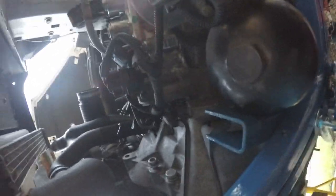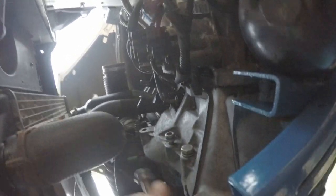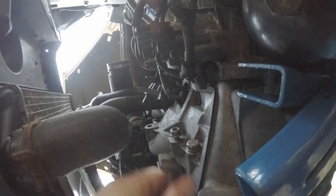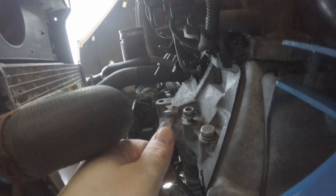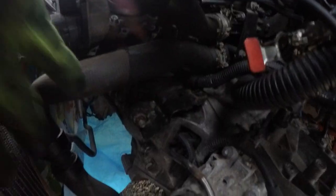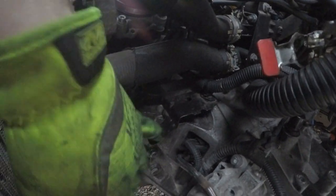The starter motor has got two hex funny bolts. One goes there and the other one goes on the next one on the top. So this goes one at the bottom, the other funny one right at the top, and then you've got the other one with the little nut thing which goes above that one there. I'm going to do them at about 35 Newton metres of torque. Just cranked them up quite hard.